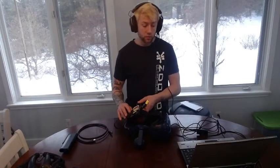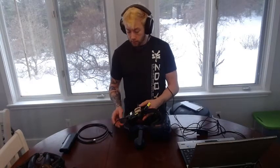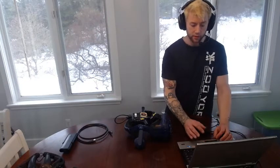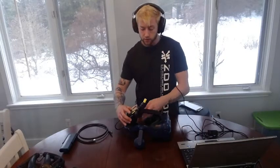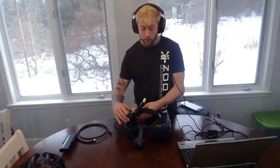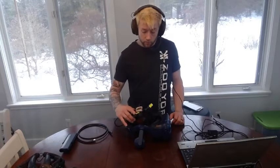With my original unit, it would get super hot and then obviously go into the blue screen and disconnect. The first fix is software-based: under your Steam VR settings, find the controller setting that says something along the lines of 'turn off after five minutes of play.' Make sure your controllers are set to never turn off. Something happens with the adapter and the headset that confuses it and puts it into sleep mode, which disconnects your wireless right away.